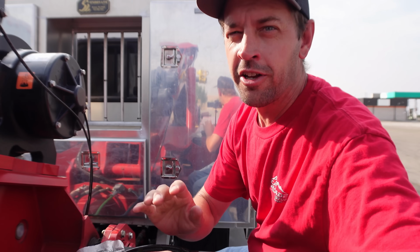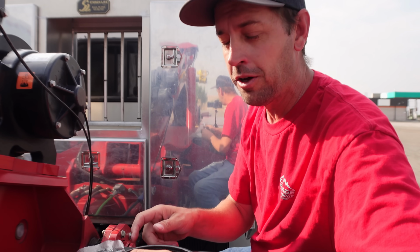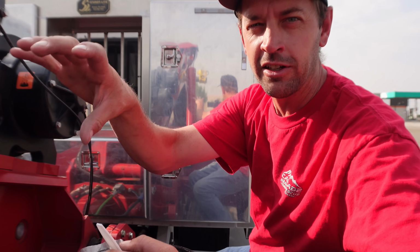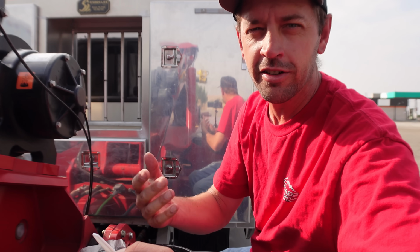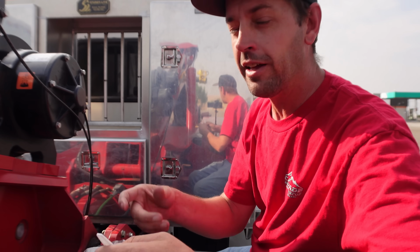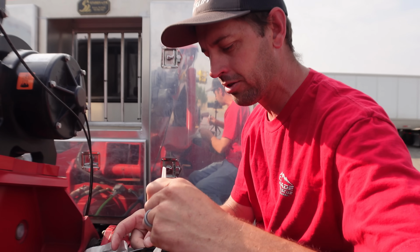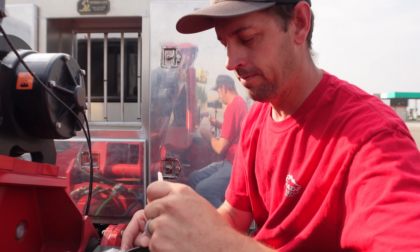Because with the long haul towing stuff, like what I'm doing here, you don't need all these winches and a big recovery boom and all that stuff. You just need the underreach off the back. And it would be nice to have just the single winch right there if you have to winch a dead truck out of a parking space or a yard or something like that. But you can absolutely have that with a fifth wheeler. All of this is unnecessary for the long haul towing. In all reality, it hurts you because it's a bunch of unnecessary weight you're dragging around that makes it harder to scale on your back axle. So that over there, that'd be the way to go.